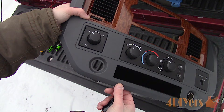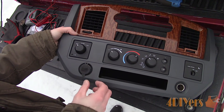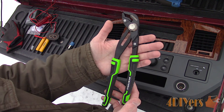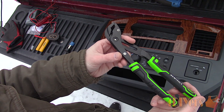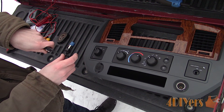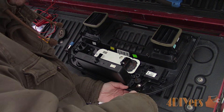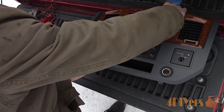After a couple of minutes the hole is the correct size. Some plastic fibers or hairs may be around the hole and this can typically be cleaned up by rubbing your finger around the edge. Install the new port — if equipped with a rubber cover, make sure it is aligned properly. This rubber cover will keep the port looking clean and provide protection from dust or dirt. Install the large nut on the rear. To snug up the nut it may be hard by hand, so interlocking pliers can be used. I'm using fine adjustment interlocking pliers made by OEM Tools, model number 22645. With the plastic nut, I recommend wrapping electrical tape around the jaws — don't over tighten it. You just want it tight enough where it won't move or come loose over time. Then verify that it's straight and make adjustments as needed.